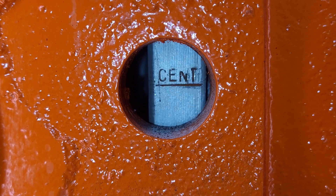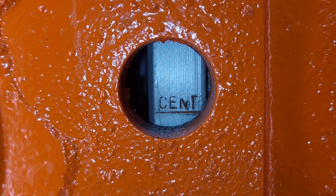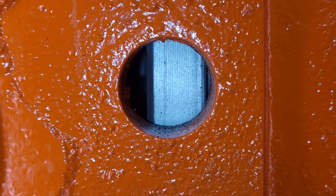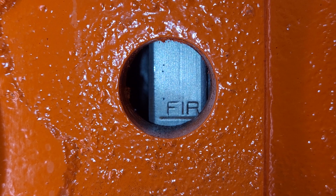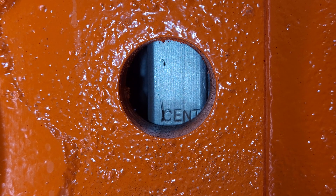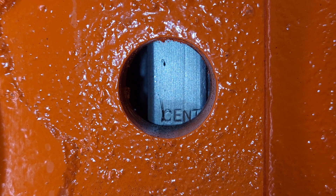We rotate 30 degrees and you see 'center' — that is top dead center. On the magneto, the good place to fire is right about there at top dead center. So when we get done, hopefully we hear the click. Now there's a couple things to note: if I rotate this about half a turn, we get another fire mark that looks a little different, and then another center mark. Those are 180 degrees across from each other, which means we have a TDC mark for cylinders one and four, and the other mark is for two and three. So we can't just set it to TDC and go with it — we need to make sure number one is on the compression stroke.